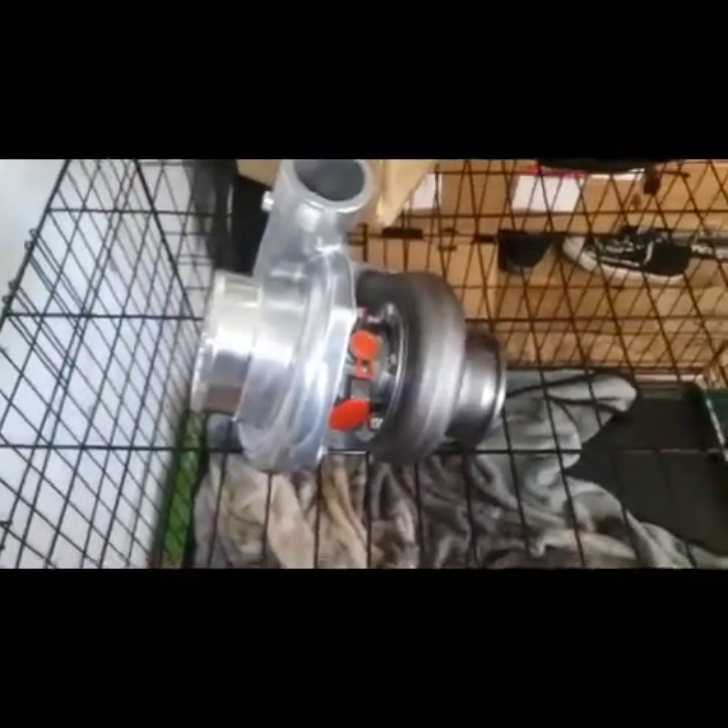Alright guys, so that's it for this video — it was just a quick video. I wanted to measure the deck on the block and the head and show you guys what was up on that. I think I'd give it a thumbs up. Just got to clean everything up, get everything prepped, hone my cylinders, set my ring gap — I'm going to make videos on all that. Get the bottom end all buttoned up, get the short block built, and in the meantime work with the head. It's almost downhill from here, man — we're halfway there. So if you guys liked the video, click that thumbs up. If you want to watch more videos on the channel, make sure you hit that sub button, and be sure to hit that share button too — that helps me out. Catch you guys on the next one.